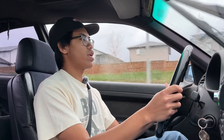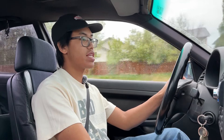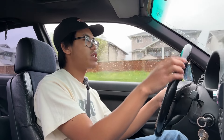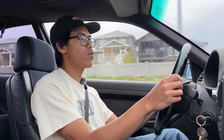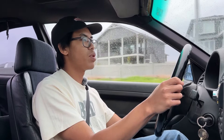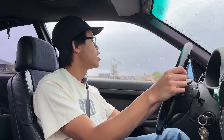I can't really think of what else to look for when buying this car. Your onboard computer can give you false readings — I've read that people can disable all the codes, which is bad if something is wrong. My car is OBD1 so you have to do like a pedal dance, or there's a trick with the pin connectors in the engine bay that you can use to read your codes. Overall, the biggest things to check are the cooling system, body rust, and making sure the motor is healthy with good compression and leak down numbers.